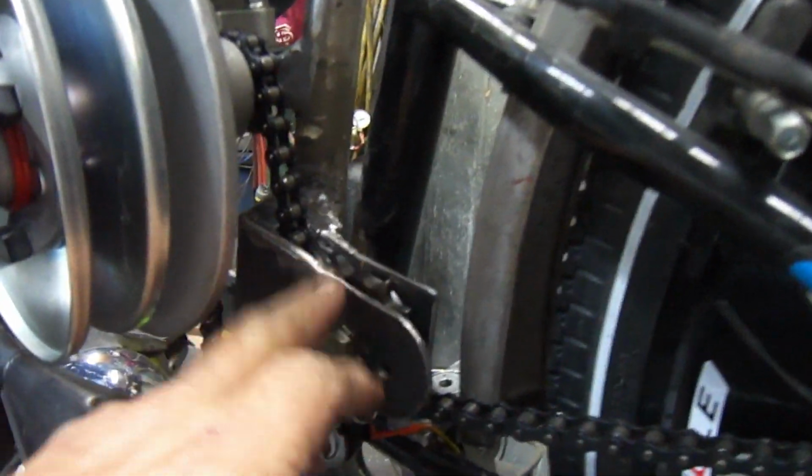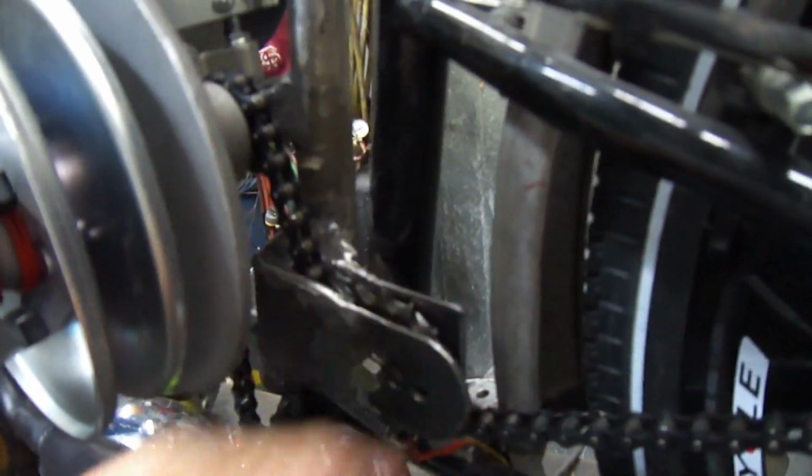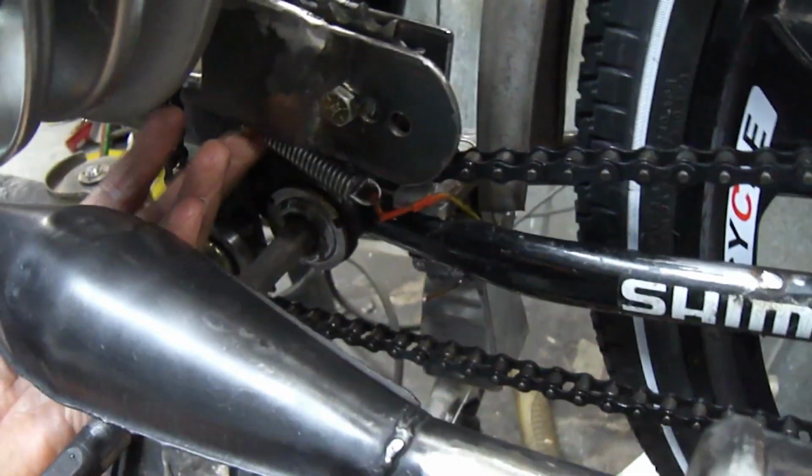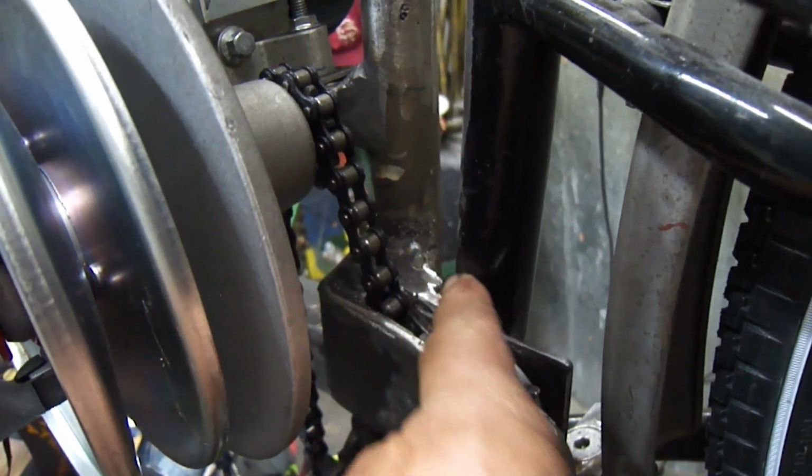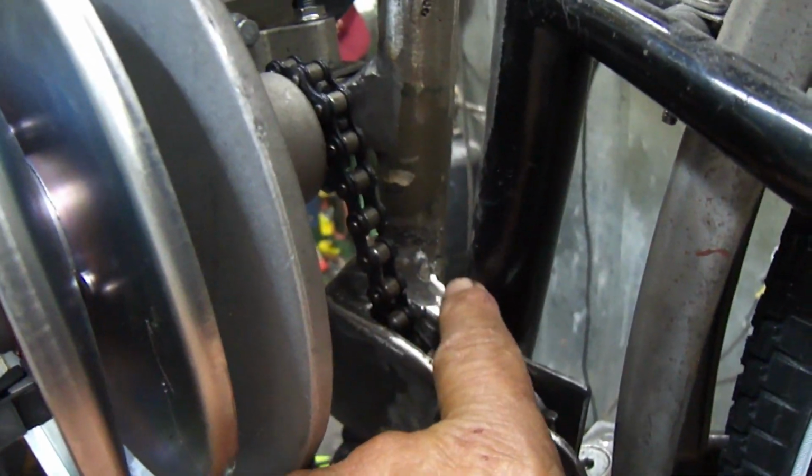And this is where it is. I cut it off. If that's out of whack, I'm about to cut that. That thing welded good on there. Trust me, it's welded good. I needed to show y'all the video how I did it, but here's one piece of 1/8 flat bar running around the route. Another piece of 1/8 flat bar pulled in an angle in the back. Then I have another piece of 1/8 flat bar coming across to this. Then I have a piece of flat bar on top. So it's pretty doggone rigid. I didn't want it to move.